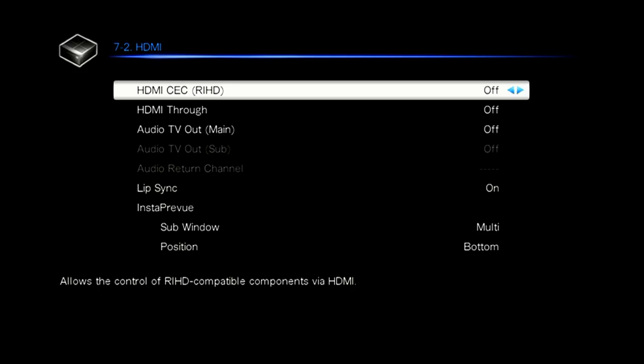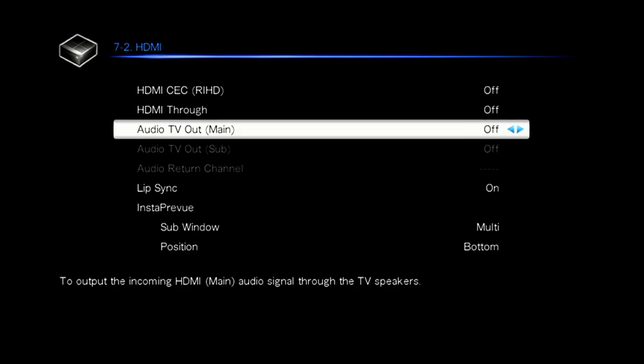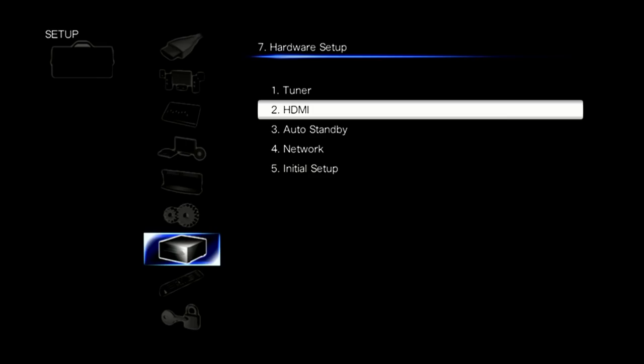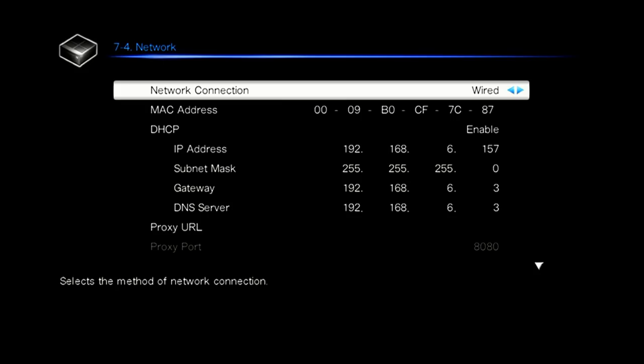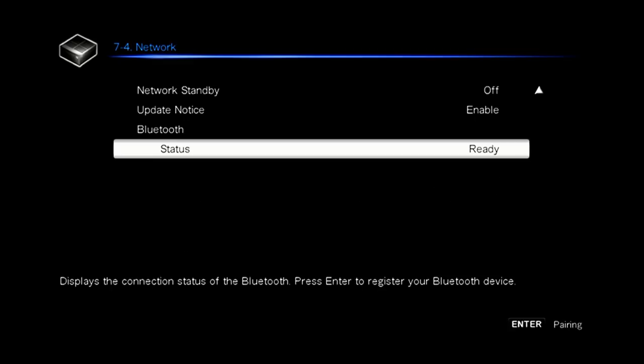There are more HDMI settings here — you can turn the CEC control off, which we find quite problematic with most televisions; it doesn't always work as expected and can cause other issues. You can tell it to pass through audio when the amp is turned off to the TV. It defaults to turning itself off if it doesn't receive a signal after a certain period, which you can disable. In the networking menu you can manually configure a static IP address or let it pick one up from your router — we recommend fixing it to a static IP as that solves a lot of network problems.